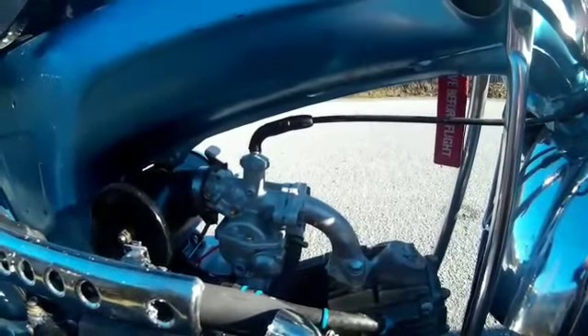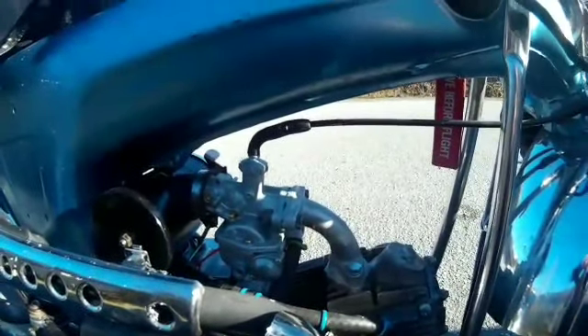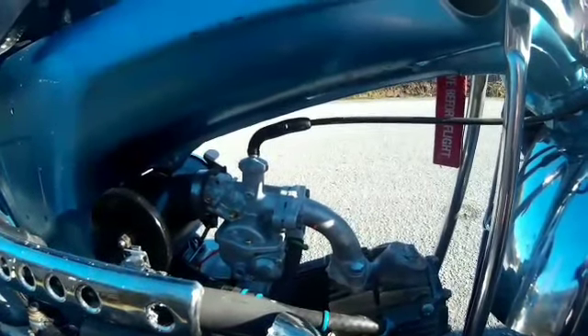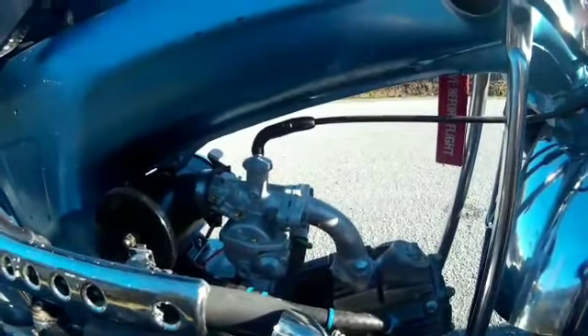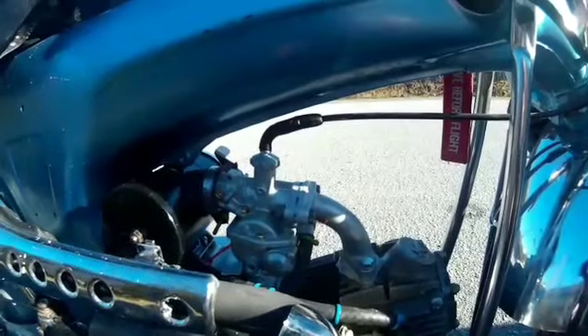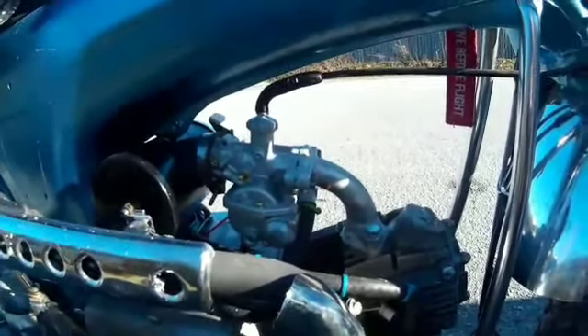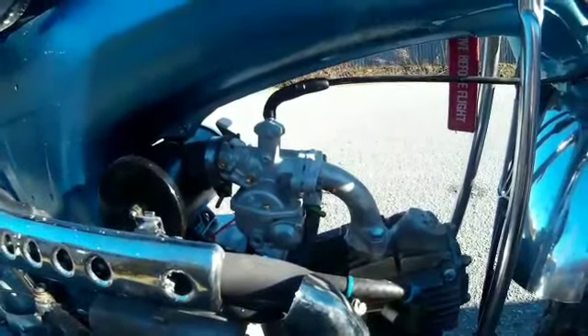The coil is the original coil — I didn't change it. I did change the wiring on the firing plate — not the condenser, but the windings for the lights and for the coil. I did change those, so maybe they're no good. But anyway, let's give this a try.